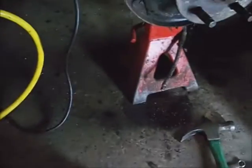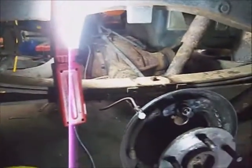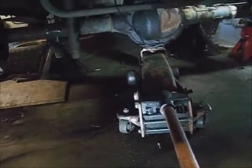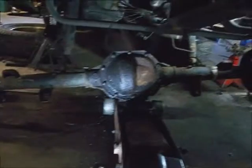It's just been held up by the jack stands. Now it's time to put a floor jack under the center of it and let it down out of there. You might tie up your emergency brake cables just to help hold that mess up back there if you left them in.